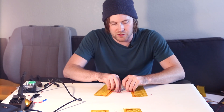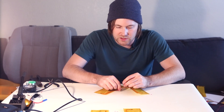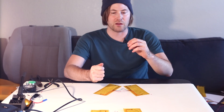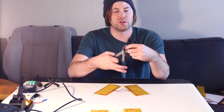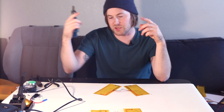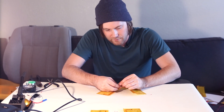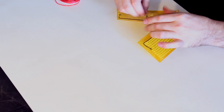I'm going to show you how I twisted together all the connecting wires. I've done it with my hands, but I've seen tutorials where they'll put the wires inside of an electric drill on one end, and on the other end they'll put tape around some pliers. They'll put electrical tape on the plier ends so it doesn't cut open the wires, then have someone hold it and run the drill — it will twist the wires together and make them look really good. You just have to leave a little bit of extra wire to accommodate for how much will be taken up by the twisting.